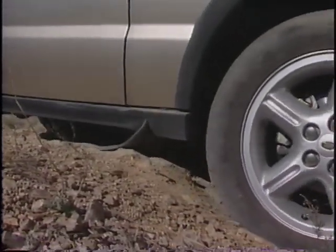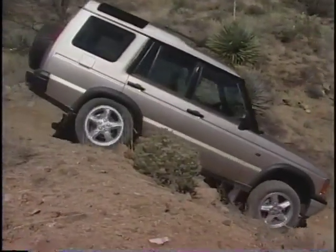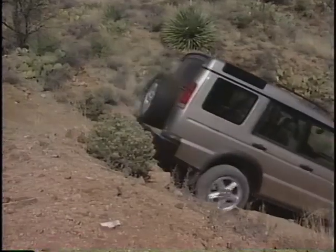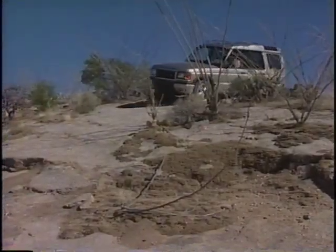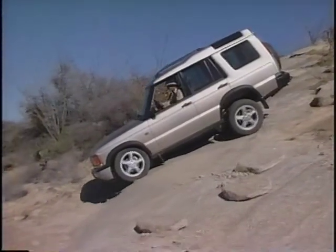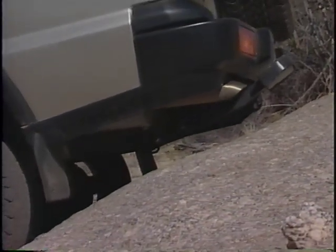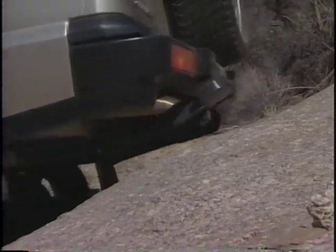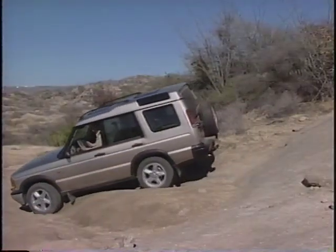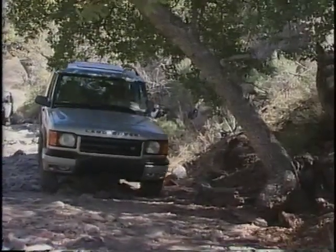Once again, drive over very slowly. If your vehicle is equipped with self-leveling suspension, rear clearance can be increased — push the SLS button and the rear will rise about one and a half inches. In all situations involving clearance angles, driving slowly and smoothly will help to avoid damaging the vehicle. Once clear of rugged terrain, resume normal ride height.